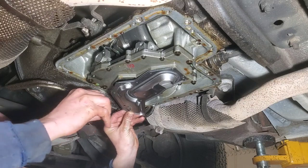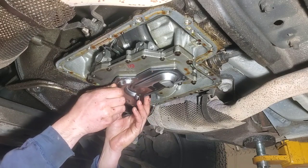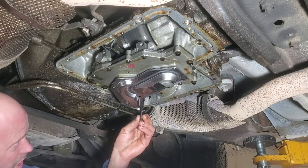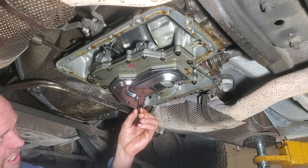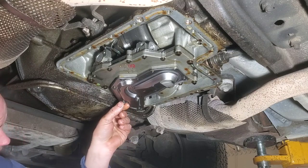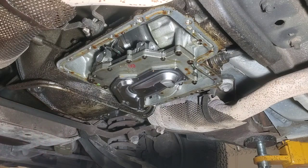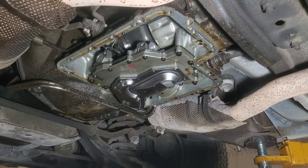And I'm going to take just one of these regular 5/16 ones and go here, because they're all the same. And now I'll take this 3/8 headed one, stick it clear over here, because that's where it came out of. Then you're just going to go ahead and take this other 3/8 headed one with the shoulder on it, stick it back here. Remember, this is the one that fell out on us. The rest of the bolts are all the same length, so it doesn't matter which way those go. So I'll go ahead and just pause it and get all them started.